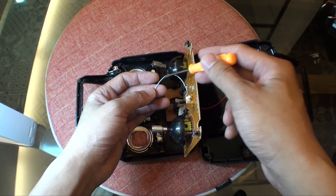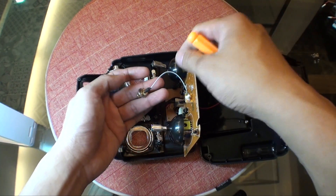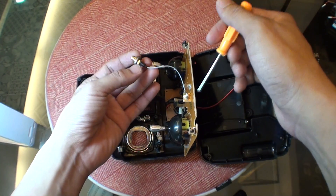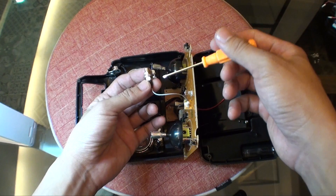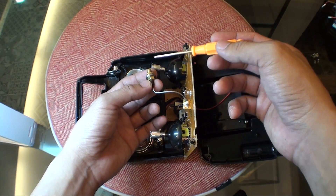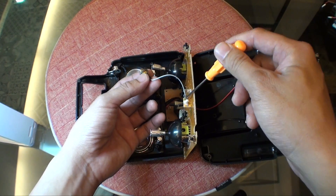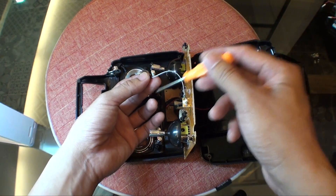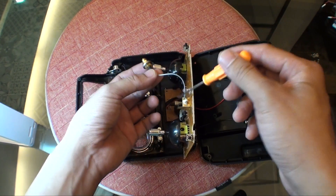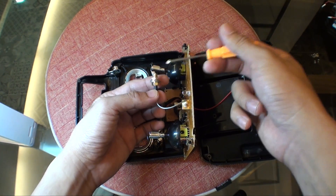When you open it, you will see a little wire connecting to a small board that sits perpendicularly to the main board. There is an existing wire of about this length — cut it off and replace it with the antenna base taken from the wireless router. Get the antenna base along with its wire, remove the existing wire, and stick this on. This will allow the antenna to be screwed onto the antenna base later on.